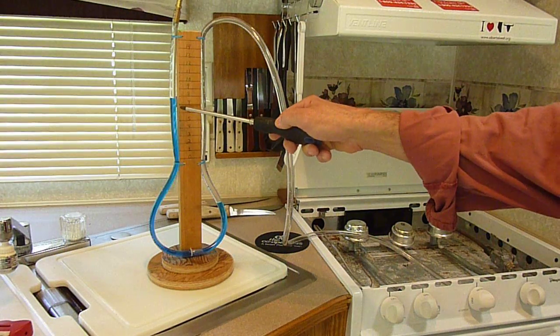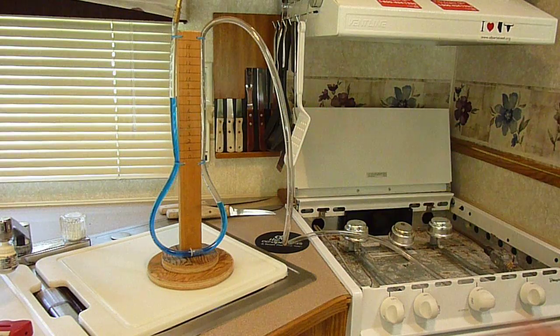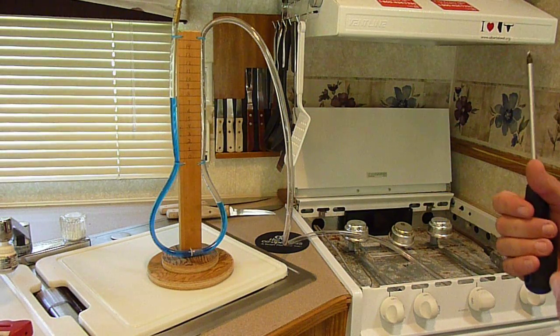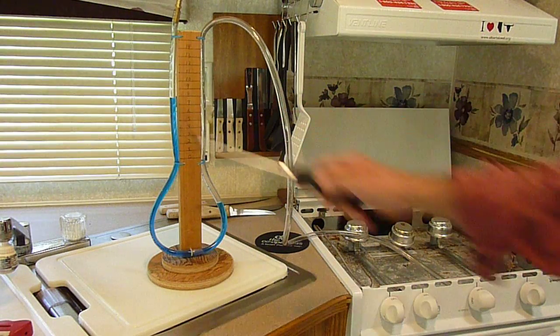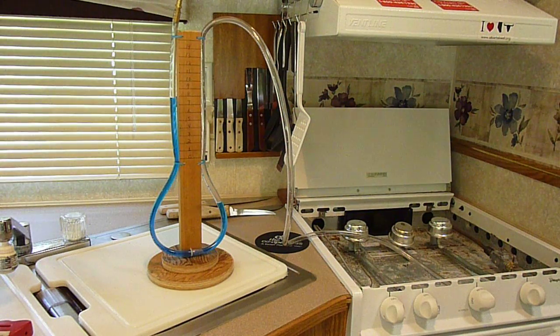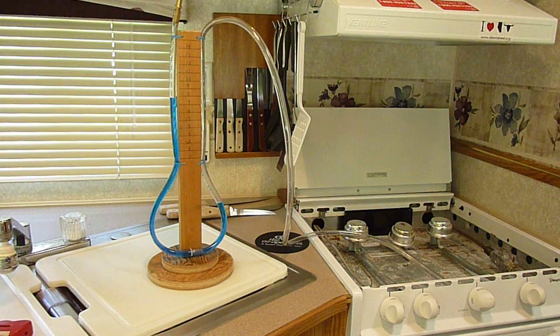Keep in mind that a one-half inch increment probably represents a cubic centimeter — a very small amount of propane, not something to be worried about. However, if the reading dropped all the way to zero after a couple of minutes, we'd know there is an extensive leak. Everything is fine on this RV — thanks for watching, bye now.